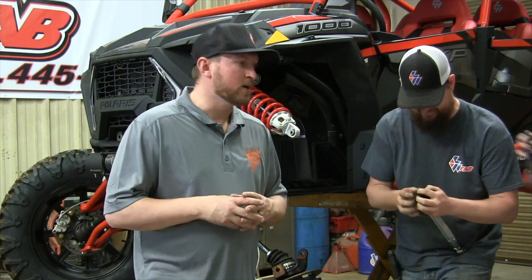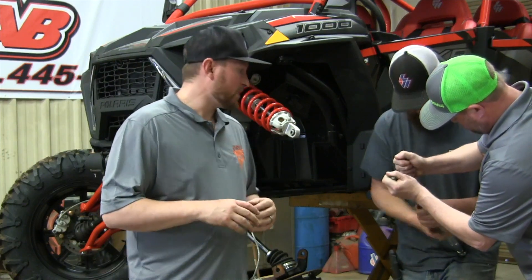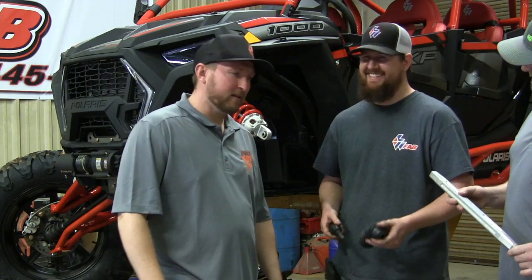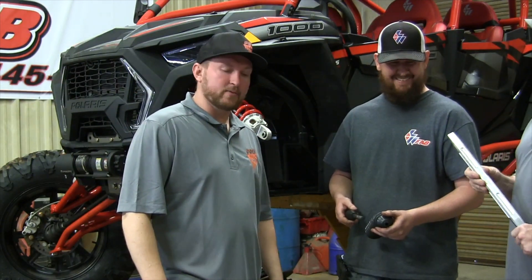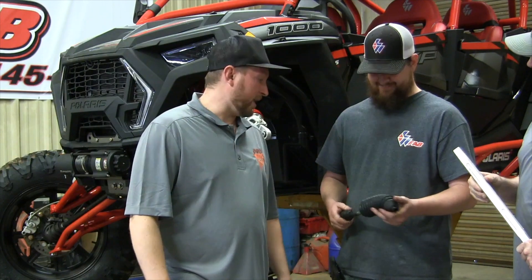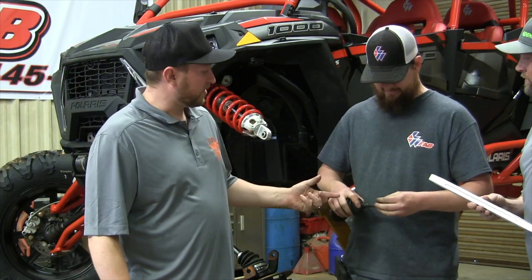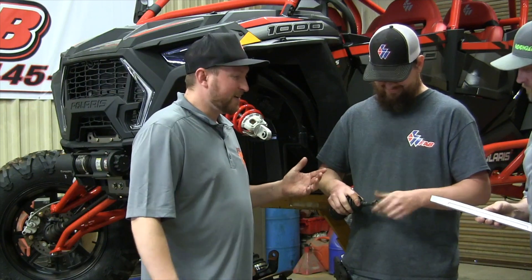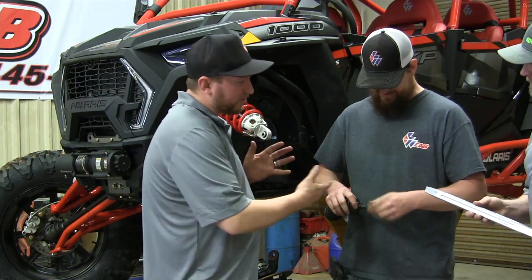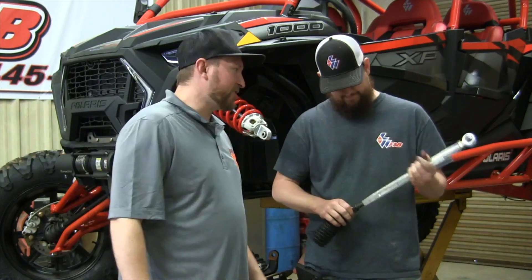Some of you guys may have boot stretching tools. We're just manually doing this today to show you that it can be done. After about three days of struggling, I told them to do it the wrong way and Levi was listening to me. Actually, this just slips on this end because of the style — you take the jam nut, run it onto this, then take this side and put it into the end of the steering rod and your boot's already assembled. It's very simple, a smooth process. That whole struggle was just us being funny.